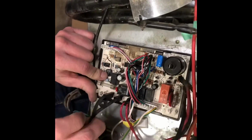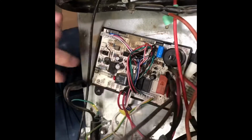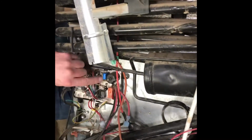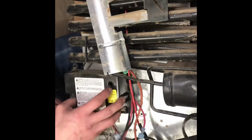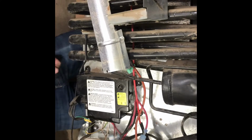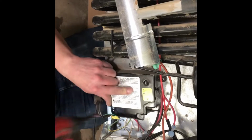Okay, so these two here are heaters. Now unplugged, you can pull it out of the little burner tube there. Once that's out of the way, because the board's going to stay with the fridge, I will just put one screw back into it just to hold it in place. There.